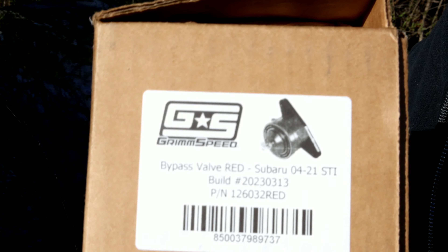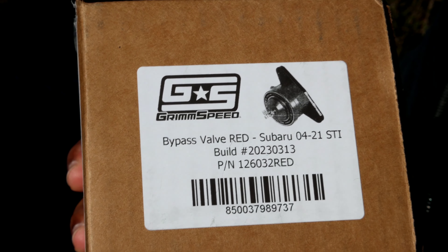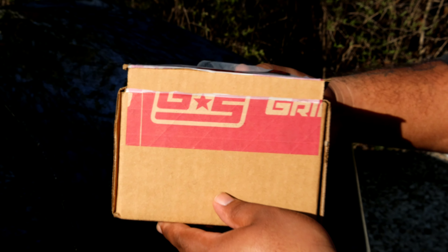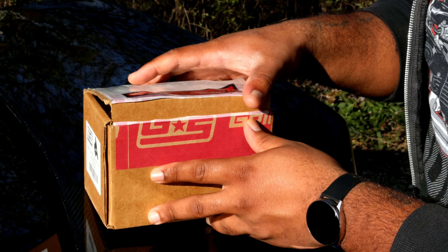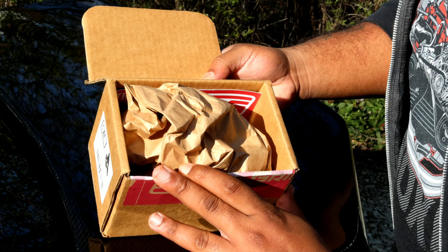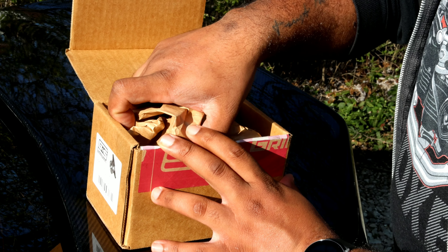What's good, you guys. So you read the title — this is gonna get a lot of traction because my last blow-off valve video got a lot of traction, a lot of questions, a lot of people not understanding that you should not use a vent-to-atmosphere blow-off valve when you're not tuned for speed density.